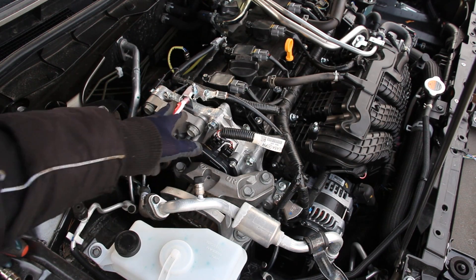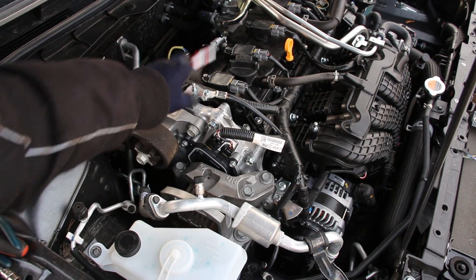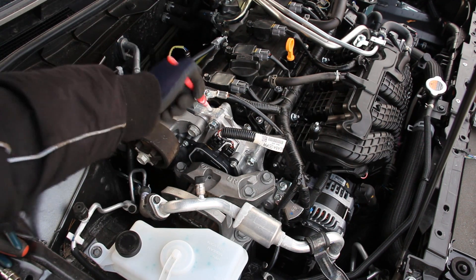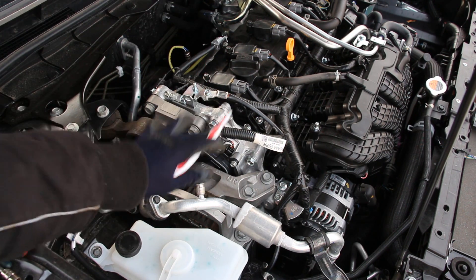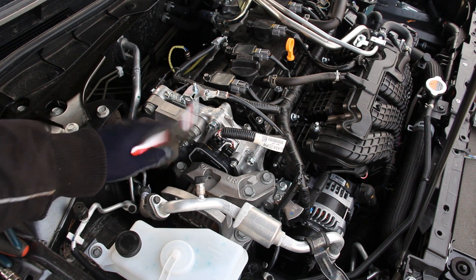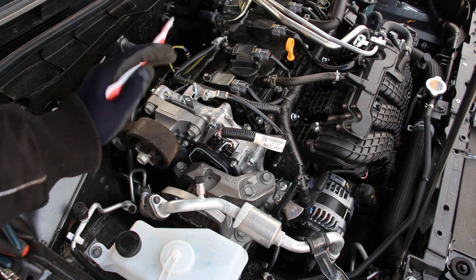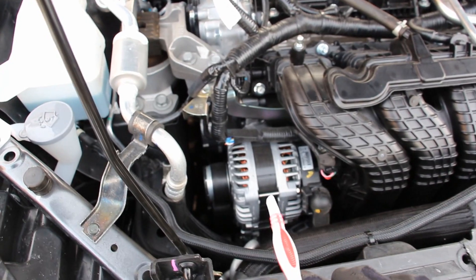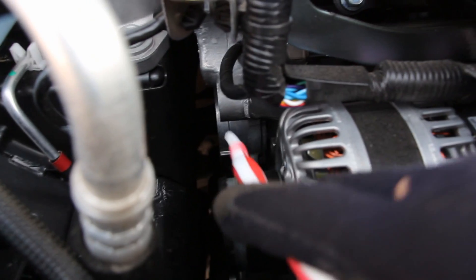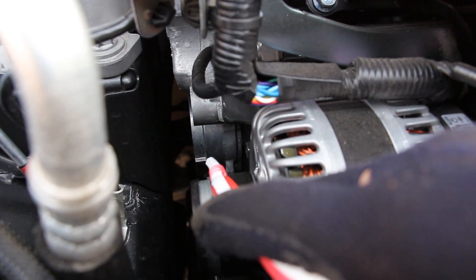Now on the passenger side of the engine we have this little hook here which I don't think is strong enough to hold the weight of this engine when the CVT fails and you have to swap it out. Nevertheless, under this timing cover we have a timing chain — one that goes to both camshafts and another that goes down to the balancer and oil pump. This is good because you don't have to service it over the life of this engine. Right up at the top here we have the alternator and it is pretty easy to change out. That tensioner is at the back here and you just got to stick a wrench on there and horse it up in order to get this belt loose.